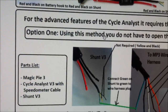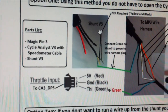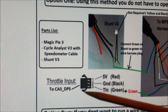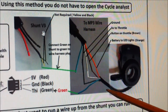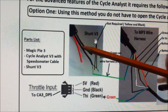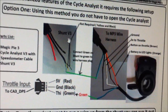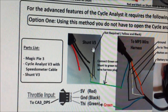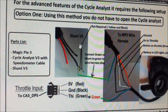The next step is how you would hook up the other end at the top. If you look at the back of the Cycle Analyst you can see a three-pin plug — it's for your throttle input. There's a green, a black, and a red wire in it. Basically you're going to run the throttle signal coming out of the throttle down the green wire into the throttle-in for the Cycle Analyst, and then the throttle signal will come back out of the shunt and run right back into this wire and continue on through the wire harness to the controller on the Magic Pie 3. So all you're doing is running the throttle output wire through the Cycle Analyst and back inline towards the controller.